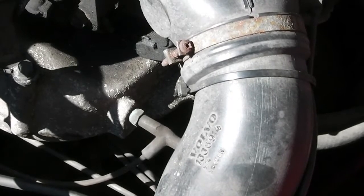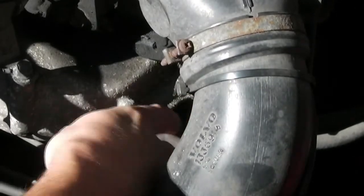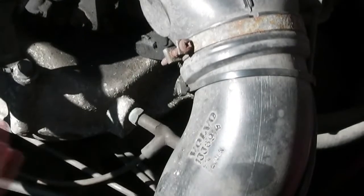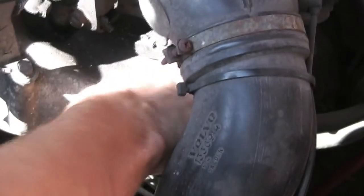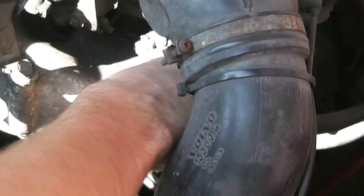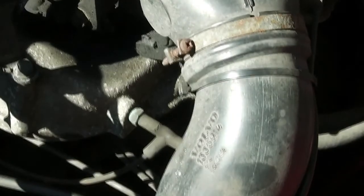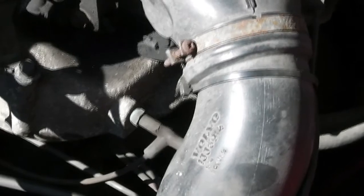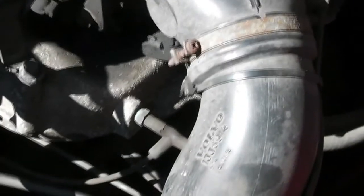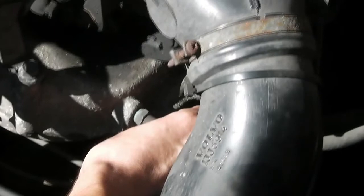I just left the choke on a little bit more to give it a bit more power. You can see this has almost gone flat now — this joint is compressed to almost a flat shape. And you can see as I move it... it's not so apparent now because the choke's frozen off. As it gets to a slower idle, there's actually a noticeable sucking noise, and then as you restrict this...